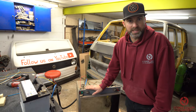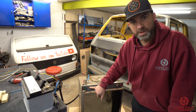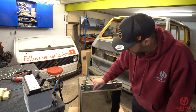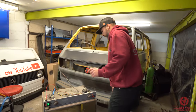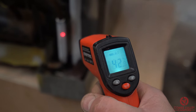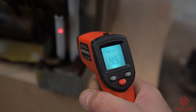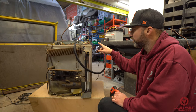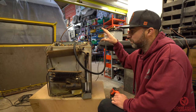We've now plugged in the 240 volt AC on our test lead. We're going to turn it on via the green switch and then turn it all the way up to number eight to see if the heating element at the back works. That's lit up — that's a good sign. Just heard it click on. Going around the back, you can already see that the temperature is increasing quite quickly. Whilst we get set up to test the gas side, we're going to leave that on 240 volt and then start checking the temperature all the way around and on the inside.